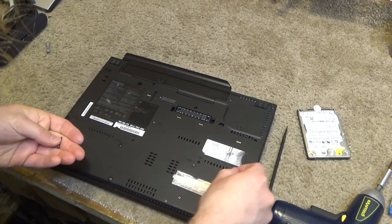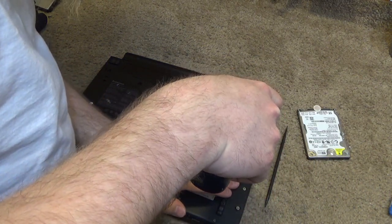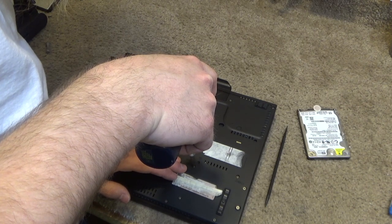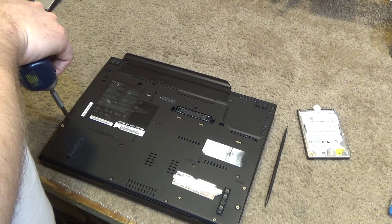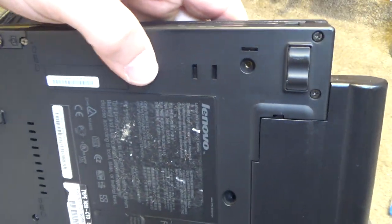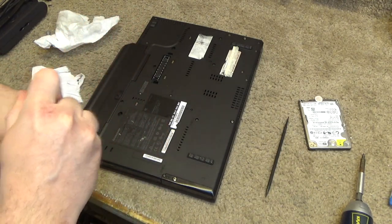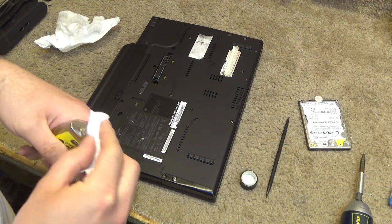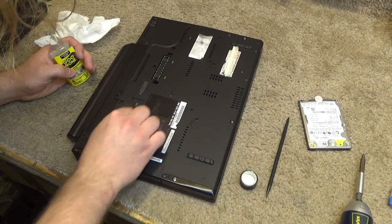And then I have to clean it — there's some sticky residue on there, so we'll try to get that off, and then we'll check the BIOS and make sure that it's recognizing the memory and the drive. I don't know what that is but there's something sticky on there. We'll try to get it off with Goo Gone. Looks to me like sticker residue — there might have been some kind of a sticker over there for who knows what reason. Just don't want to do anything too harsh that takes off the information labels as well.